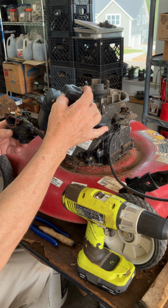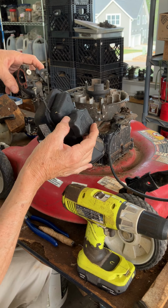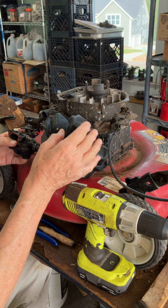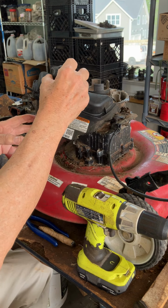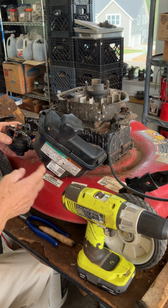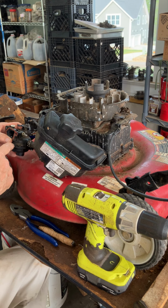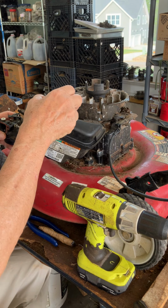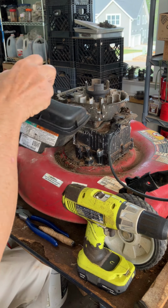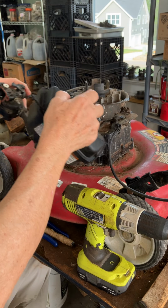And also the fuel that's in the carburetor, this is true for the Quantum too, if you take it off as a unit and turn it this way, you're going to get a lot of that fuel drained back into the tank. So you have less mess to deal with. You don't have fuel leaking out all over your mower when you try and take it off here. You may use something to pinch that off, but even with that, you often get a little bit of leakage, and then the carburetor also will leak when you try and get it off if you turn it sideways or something like that. But if you just take this off as a unit, then go set this somewhere like in a block or an upright position. Just let that drain out for a little while before you take it off.